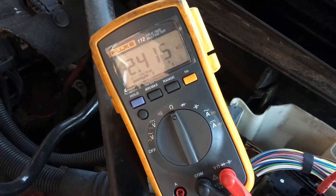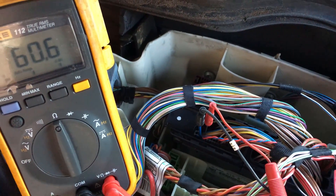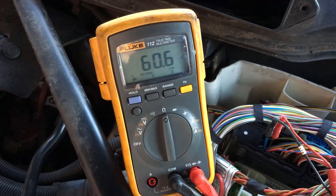This is the reading you get if the CAN bus network is not asleep. The basic idea of the resistance check on a CAN network is to measure between CAN high and CAN low — a good reading is around 60 ohms. A lot of people get hung up on this resistance check, and it's recited in technical training time and time again. However, it's a flawed test if you don't understand it fully. High speed CAN bus has two 120-ohm resistors connecting the CAN high and CAN low lines internally in two control units.